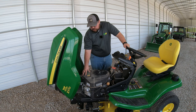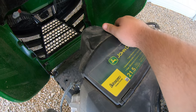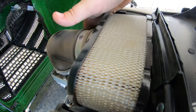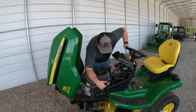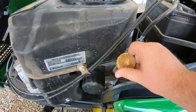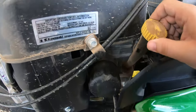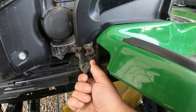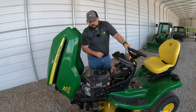So, 21 and a half horsepower. That cover also serves as our air filter cover — raise it up and you have access to the air filter. Simply raise that out, take the clamp off, and change out your filter. Over on the left-hand side are all our oil change and checking components. We have our dipstick here — untwist and pull it out — and this is also where we fill engine oil. Right below that is our oil filter, and below that is our tool-less oil drain system. Simply take off the cap by hand, drain the oil, screw it back in, and proceed with the oil change.